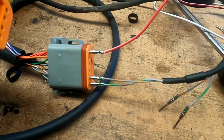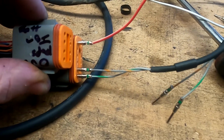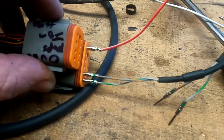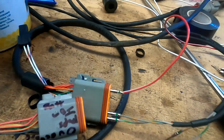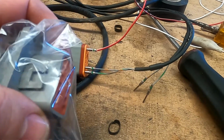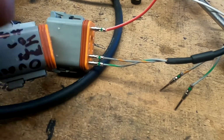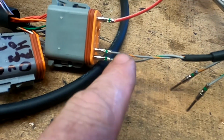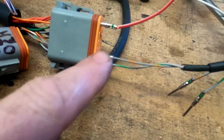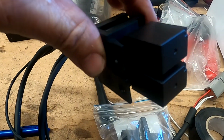And what I've done basically is just lay that along there like that. The 8-pin it's going into, you just swap them into the 12-pin and they just go 4 on the top, 4 on the bottom. The extra wires are getting added in the extra 4. There's the 2 for the reverse. Now, I've colour matched them. And it goes to one box, or just a pair of relays as a spare.